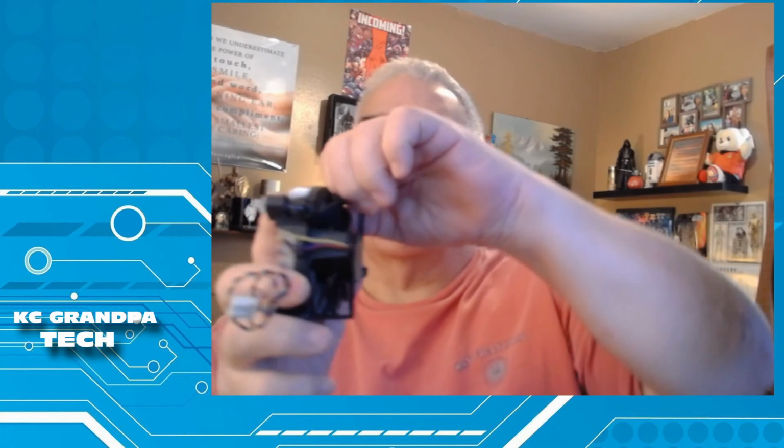So let's finish up. The bottom line is, if you have a standard desktop computer that you purchased, and you notice that your CPU cooling fan is coming on and turning high when you're doing some gaming or anything else, you probably need to improve the cooling in the system. One way, of course, is that red cooling fan I've added to increase the flow in there. But in my particular case, my computer came with a small cooling fan that uses these push pins, which you basically turn to open. And I found one that was identical to it, except it did more cooling.